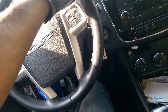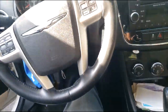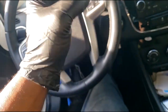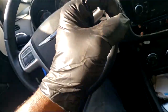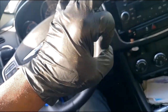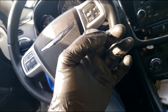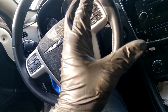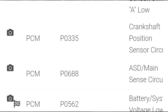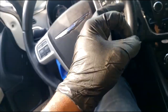Welcome back. I want to apologize — I may have led you guys astray. I may have missed a step. What I'm about to explain should have been Plan A. I just decided to scan this thing. Remember, the car was dead so I had to get my jump box first — you can't scan a dead car. Once I had the jump box hooked up, I connected my scan tool and, lo and behold, I see a P0335.